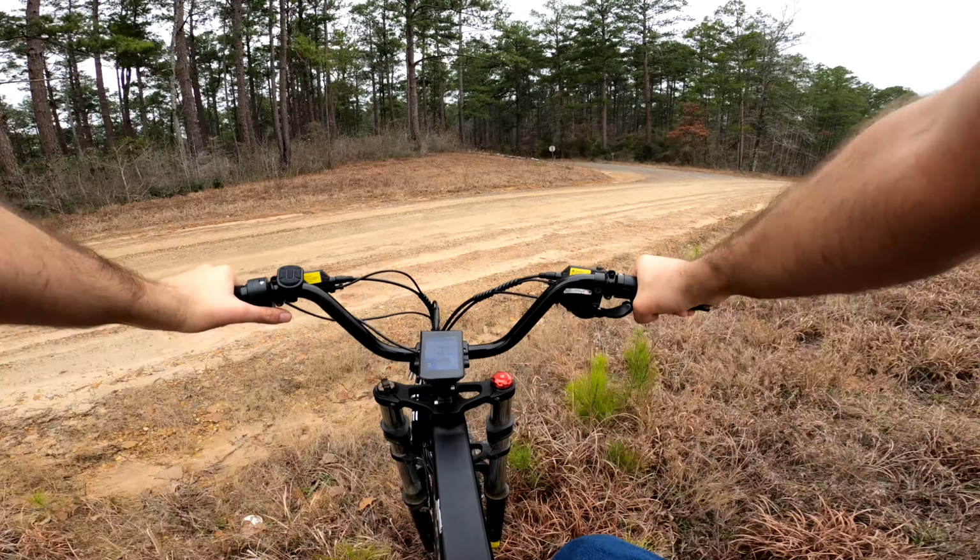Don't get me wrong, on smaller diameter tires like 20 and 24 inch, I like the alloy wheels as they're a major relief when it comes to maintenance. But on these larger diameter tires, I prefer spoked wheels just for the added safety concerns. Alloy wheels don't handle flex and fatigue nearly as well as spoked, and if you've ever had one explode on you unexpectedly, you'll never go back.